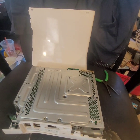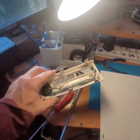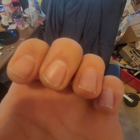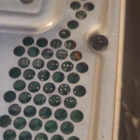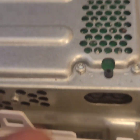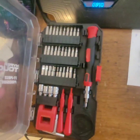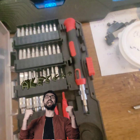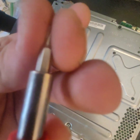All right, we've gotten this far. Let's keep going. Ow, my nails hurt — I've been prying with them. Now we have to take out these black screws in order to get the bottom piece of casing off the Xbox. Let's get to it. We need a T9 — there it is, T9 security bit, locked and loaded.